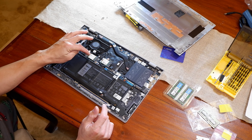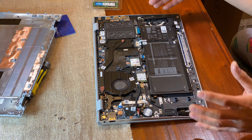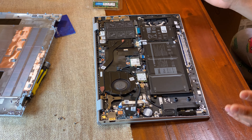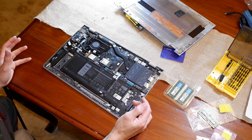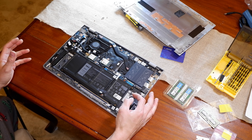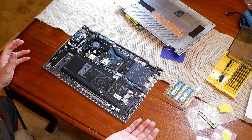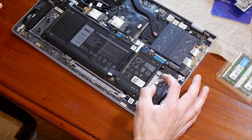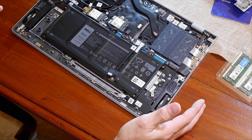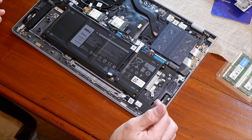The second slot doesn't have any of its hardware. When this computer first came out a couple months ago it actually came with the heat sink and everything you needed to put your SSD in, but they cheaped out and quit putting it in. So now we have just a blank slot — it's missing the heat sink, missing the hardware and screws, so you have to order that stuff from Dell.